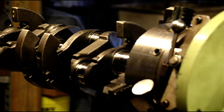Over here on the crank machine again, going to finish up Brian's crank. I've got the number four journal on the rod within a half a thousandth. I'm going to take a 400-grit belt with some rouge on it, polish that up and get it down to final size. Once I do that we'll go over the numbers and I'll show you where his crank came in.